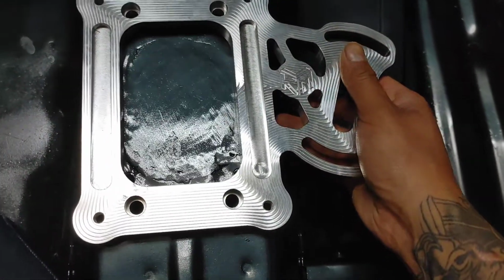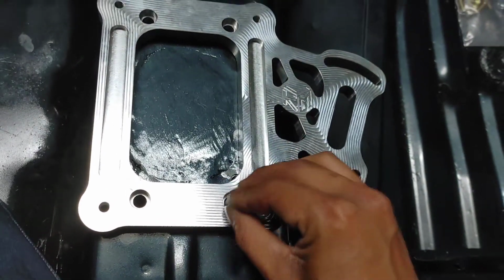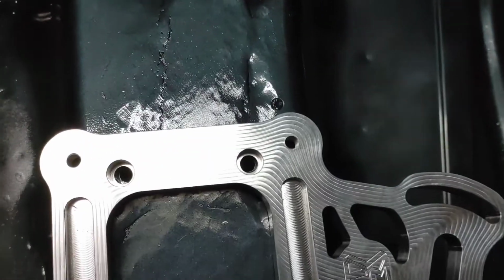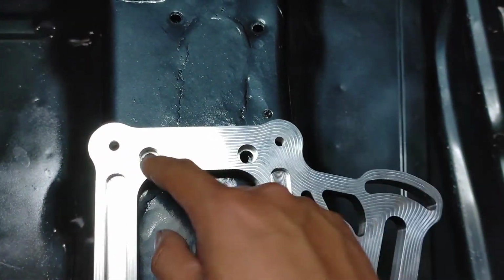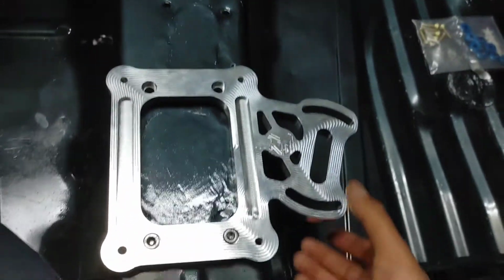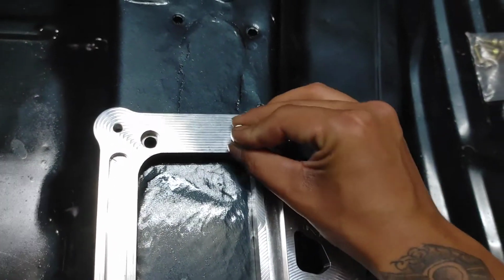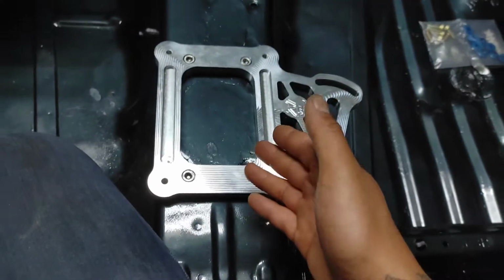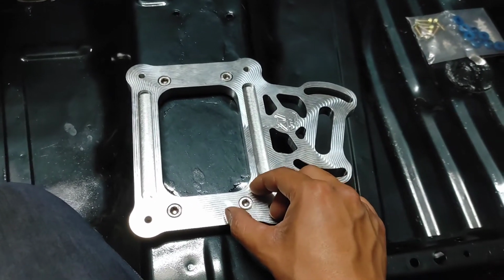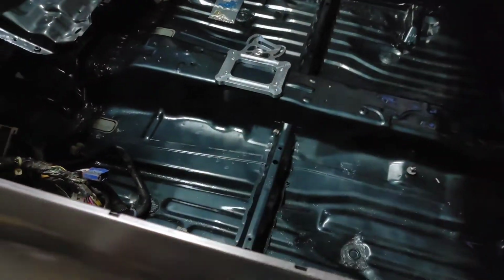So once you line up your back holes, right here, pause. These 2, once you line those up, what I did was drop these in, see where I wanted my plate, which I think was around right here. You'll see, yep, we line up these holes. So all I did was mark it, take this plate off so I didn't damage the plate by accident. Whenever the drill bit went through, I didn't want to nick it with the drill. So you take your plate off, drill your holes, put these back, put these bolts in, and then meet it underneath the car with the lock nuts and washers. I'm using washers because I feel like it's extra support because it gives a wider base for it to bolt up to. I guess I gotta wait till D-Wix gets home because I definitely cannot tighten that without any help.